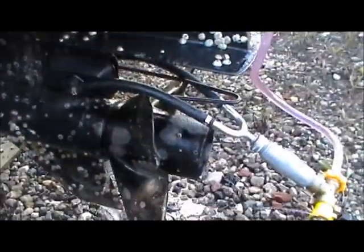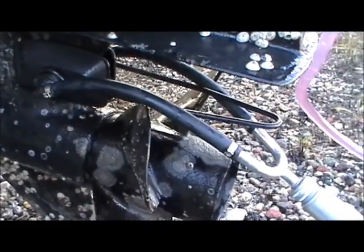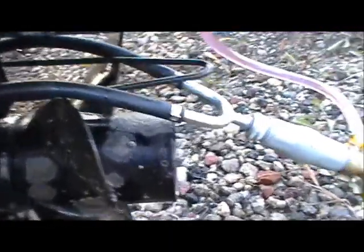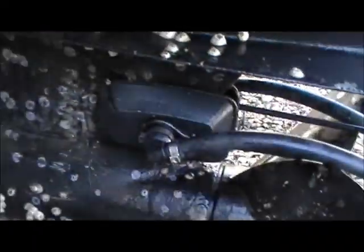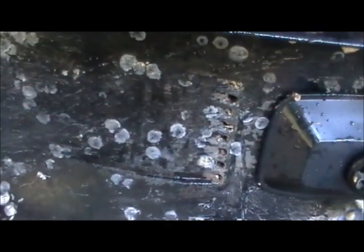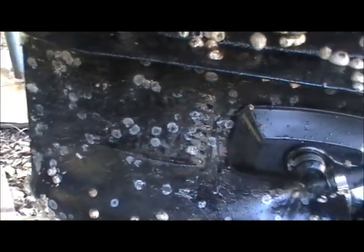Okay, we're back. Now I got it fitted on there. I just call this an earmuff kit. I'm sure there's some technical word for it, but you get these at West Marine or your boat place or wherever. All it is is a hose bib. It has a Y splitter, 2 hoses, and these 2 earmuff looking things. Those cover up the water intake holes on your outdrive. Just so you know, I'm working on an Alpha 1 Gen 2. That's what my drive is.